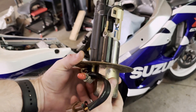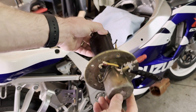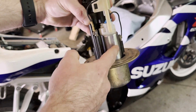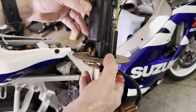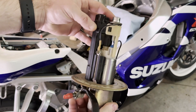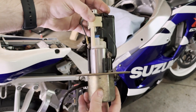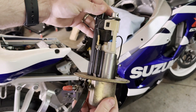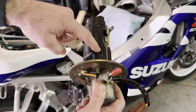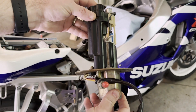Here's what the whole pump assembly looks like when you remove it from the tank. The black is the actual filter. The screen sits down in that little sump, and the pump itself is the silver cylinder that you see there. What I'm pointing at right now is where the filter media is — it's like a hump on the black. There's the pressure regulator up there at the top. This is what the whole thing looks like before you start taking it apart. We need to basically increase the fuel flow that's coming out so that we're getting the volume that we need.